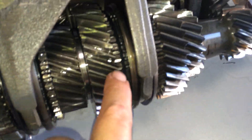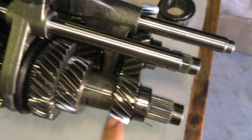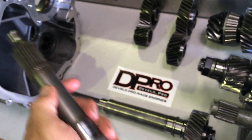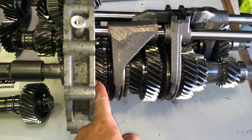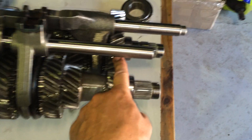If you grind a gear in most manual cars, what you can actually hear is these teeth here grinding as this sleeve — the synchro sleeve — slides over this to engage the gear, but we'll go into that another day. So we've got first and second gears here. Obviously this is our input shaft; that's our clutch spline which usually comes through the main case. So direct drive into here through our input shaft. That's the first gear driving and first driven gear.